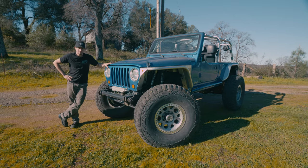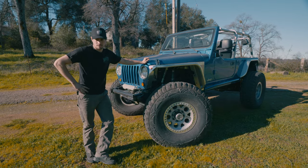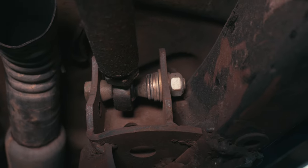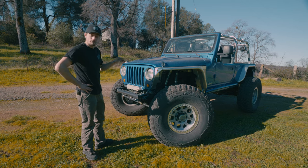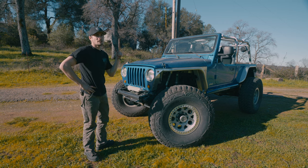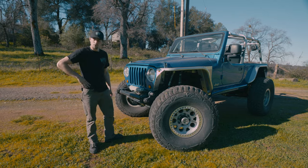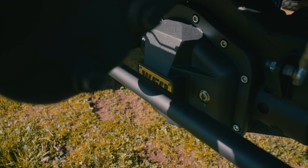Crap, you were filming that. Jeeps — everybody wants one, but not everybody knows how to build them, and this is a perfect example. This was a perfect example of someone who did not know how to build a Jeep. When this thing came in, the welds on the front — not good. All the Heims in there had misalignments, wrong spacing — throw five washers on either side, you're good. The geometry was surprisingly actually pretty good, but it had FOA shocks in there with no oil in them. Spring rates were completely off. The misalignments for the shocks — you don't need those, those weren't in there. Just tighten the bolt until it cinches it in there. Two inches up travel, didn't flex right, didn't really work right. So the guy just bought it, paid a pretty penny for it, realized all this stuff wasn't great, brought it into us, and we made her better.